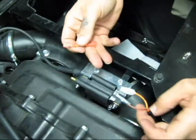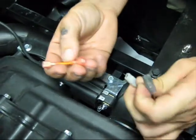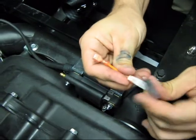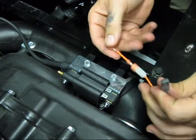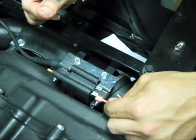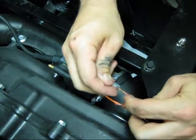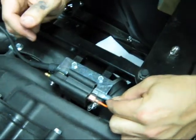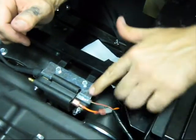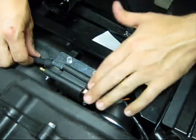To connect the primary wiring, you will need an adapter. It goes onto the orange wire, which is the coil negative, and goes to the terminal without a red dot. The brown wire with the red stripe goes to the terminal that has a red dot, right here on the coil. That's the primary wiring.